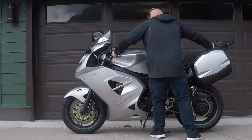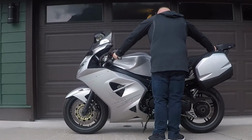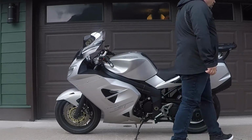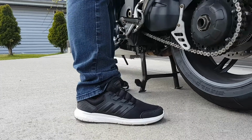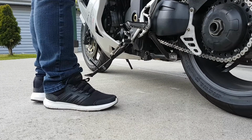Using a bit of upper body, pull the bike from the rear passenger grab rail forward while keeping the bike straight and vertical using the handlebar. The bike should shift forward and the stand retract. You do have to move the foot that you were using in front of the stand quickly to both stabilize you and prevent it from maybe getting run over.